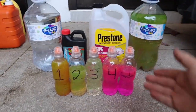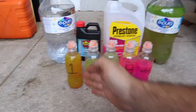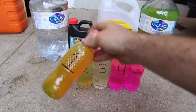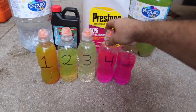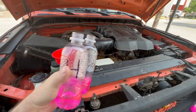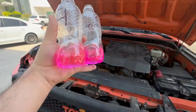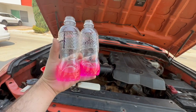That's how you flush your cooling system and end up with nice clean proper coolant, even if you had the wrong coolant in your engine. It's never a good idea to have two different kinds in there, because over time as it churns in your engine it will turn into sludge, cover up your ports, and damage your engine. Getting it flushed nice and clean like this is pretty important. A couple of days later, it's a good idea to come back and make sure it's topped off — the engine may have sucked more coolant through and it could go down a little. Also get another test after your engine has been running for a while to make sure it still looks nice and clean. In this case it does — they still look pretty much the same.